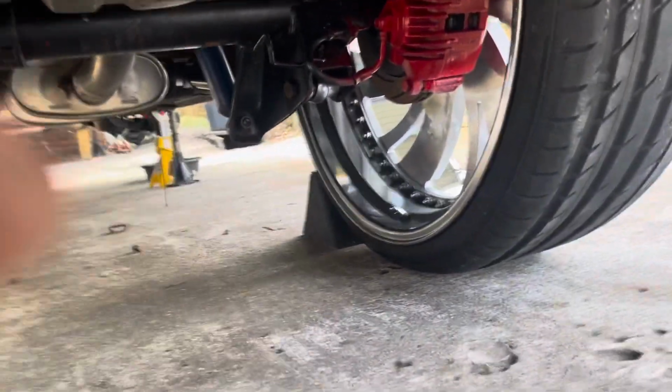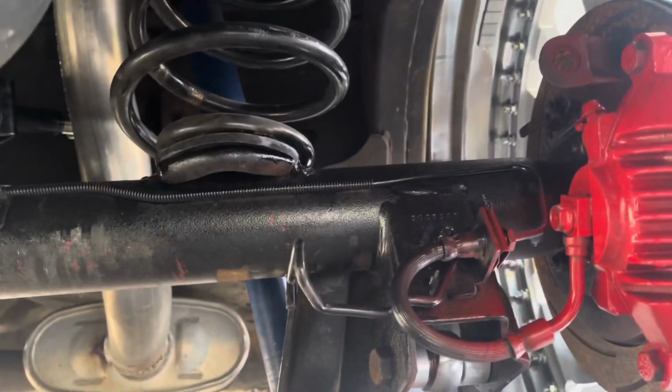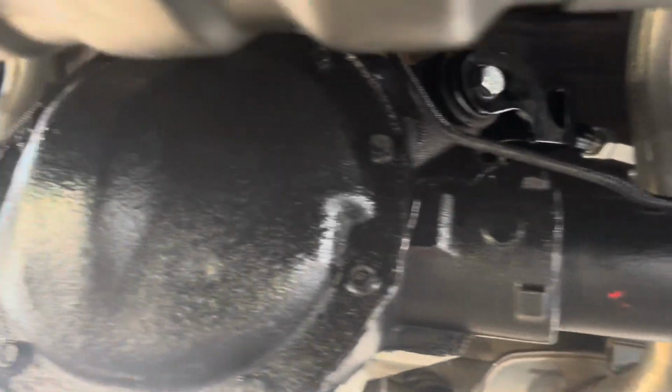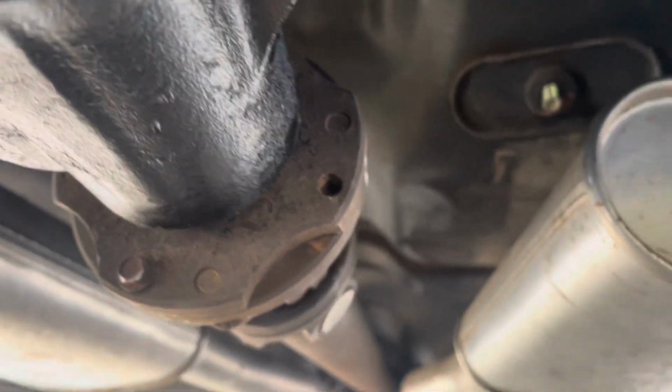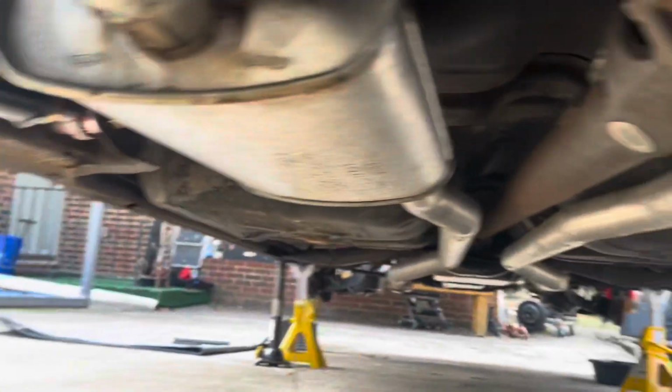Okay, I'll show you the complete. Yeah, it's complete with the wheels down on the 72 Impala. We got the 96 rear end in there with the shocks connected, upper, lower control arms, everything is complete. Even the brake line been changed. There you go, with the new control arm on both sides. Drive shaft in nice and tight, and the car is down. And I like the way that drive shaft going straight now instead of the knuckle real crimped like it do in the Donk.